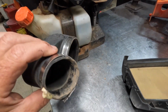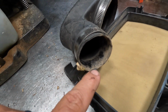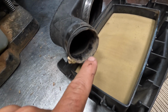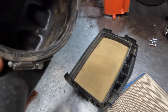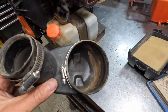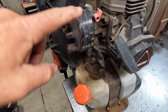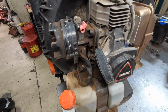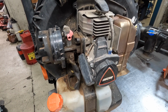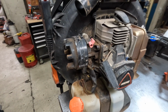So even though these hose clamps were tight, you can see where it didn't quite seal all the way around that boot, even with the clamp tight, and it will get dirt in there. So it's something with these plastics just being dissimilar between the two that's causing that. Again, some guys you'll see they put grease around it, and that does help. It's kind of a band-aid, but it is something you can do if you feel it necessary. Something to look out for.